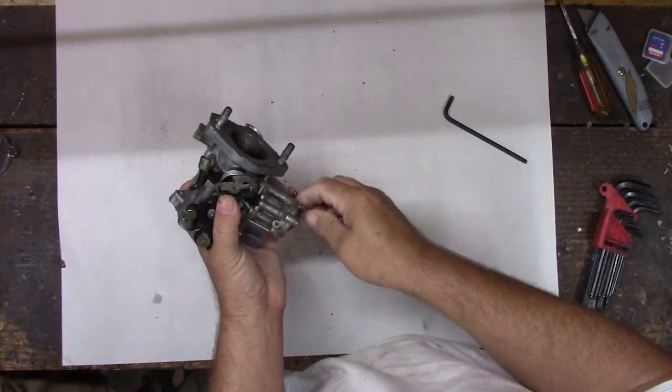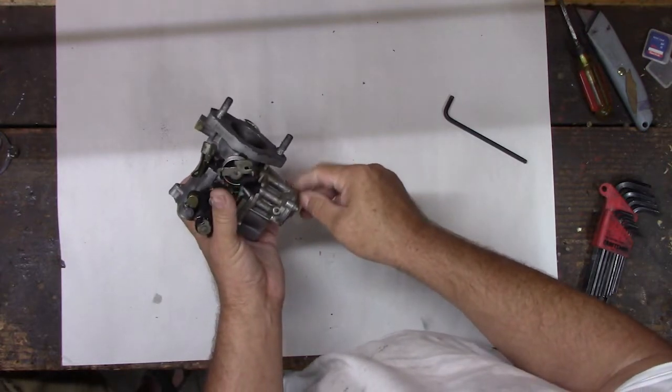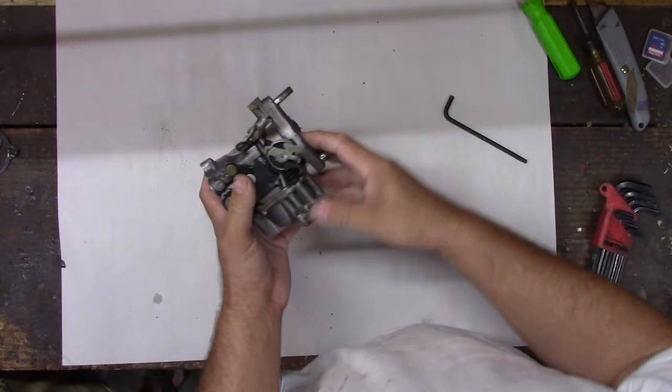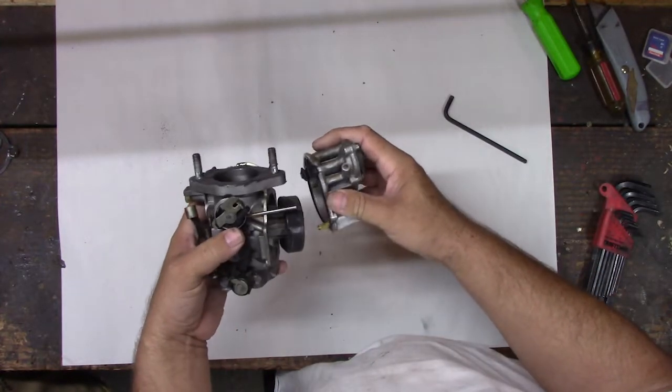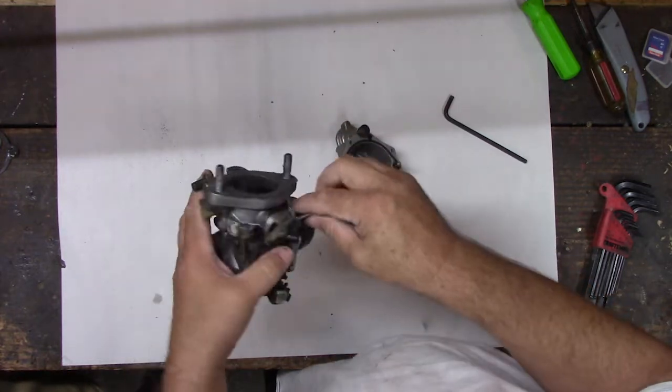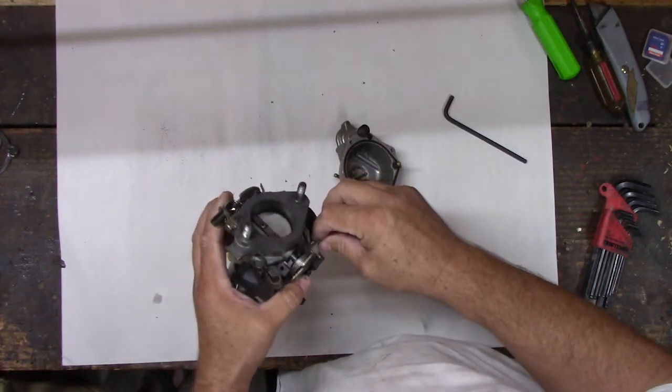If you guys are wondering how we keep the bike running, got an S&S on it right now. They seem like they should work, but they actually don't work that good. It doesn't work much better, does it? Yeah. I think it's too much carburetor for that bike. All right. I also think it's getting too much back pressure.